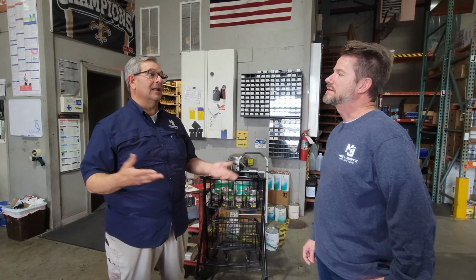So you're doing solid colors. All the Imron products are designed to be two-coat covered. That's going to save you on labor. People who have never sprayed it before, the first time I put it in their hands, I tell them all the same thing. When you put the first coat on, you're going to feel like you have coverage, and because you're a base coat painter, you're going to want to stop. You don't stop there. The second coat is what gives you the UV protection. Even though you have coverage on the first one, the second one will give you the UV.